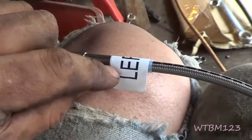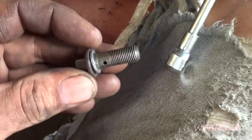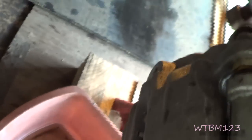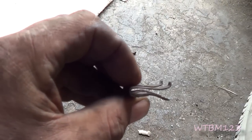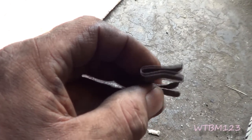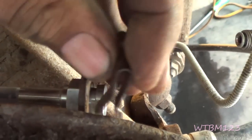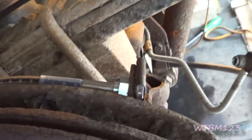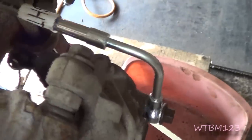What they give you now is aluminum instead of the copper ones. This one's marked 'left rear' - we're working on the left rear. You put one of those washers on, put the bolt through, and the other washer goes right here, then you bolt this right to the caliper. Looking at this clip, the ears down here have a kink or bend in them and the top is flat. With this bend, it goes back toward what you're trying to hold.